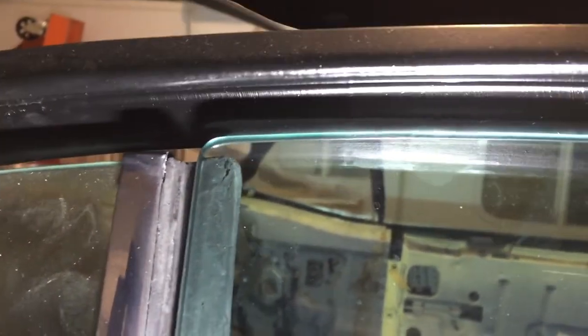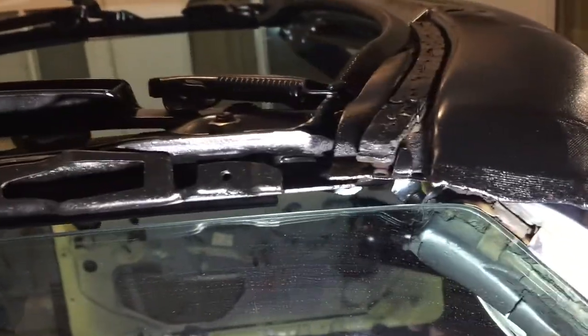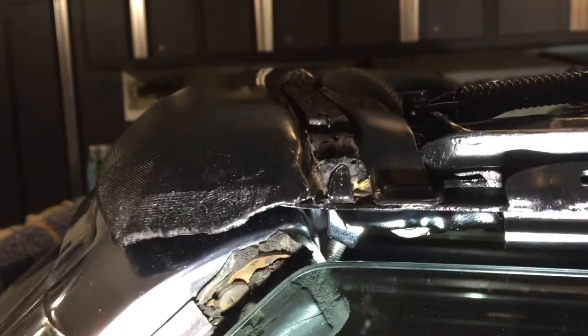It's kind of hard to make out, but you can see the glass line as it comes up to the roof line. This glass on the door is about where it should be, but this quarter glass is a little too low, and there's too much gap back here at the back. So I need to adjust this corner so that when I latch that down it will pull everything forward. You can see on this side I grabbed one of the new rubber seals and there's noticeably way too much gap — just a matter of pulling this forward and down and closing up a lot of these gaps.